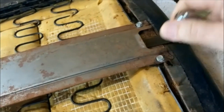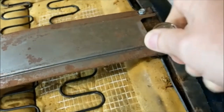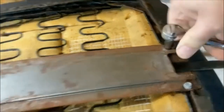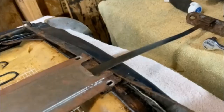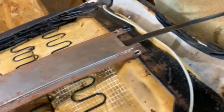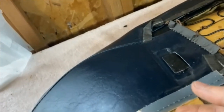Next I'm going to loosen this up because it has a hold of the fabric, so I can't get this vinyl — mostly leather, some vinyl — seat cover off. This thing has hold of it, so I'm going to take these two bolts out from the back of the seat. Now I'm able to free that up and get this part of the seat cover off. My seat cover was pretty bad, pretty worn. Up here at the top is where that plastic piece latched onto, so I'm just going to slide that up and free it.